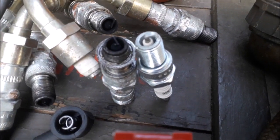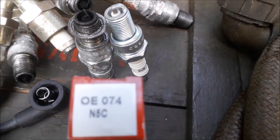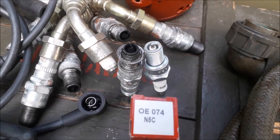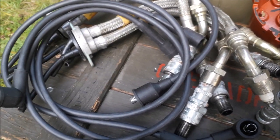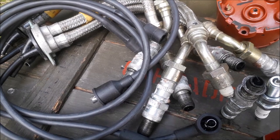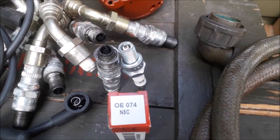The plugs — well the original ones were a bit old and sooty. We've cheated a bit and chucked in some Champion N5Cs. They do fit, and being unshielded you get a slightly bigger jump — a nice spark. But that's only if you chuck in some 7mm civvy leads. Just get a cheap lead set, they're about £15–£20. The N5Cs are £2 each — this is just if you want to do some easy diagnostics.